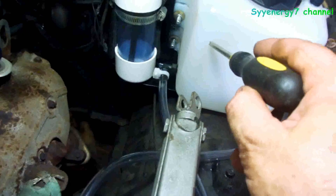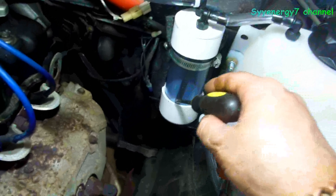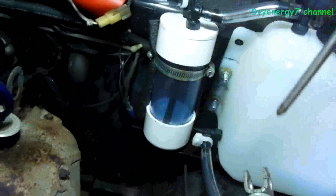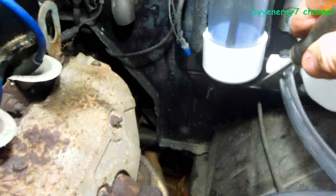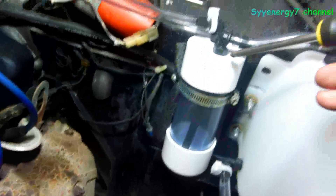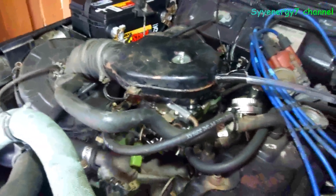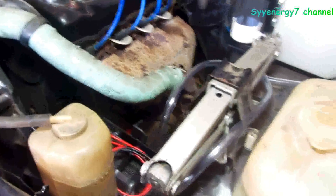So to recap the plumbing: it goes out from the reservoir to the bottom of the dry cell electrolysis unit — this is a 16-plate unit, which is oversized for this little 1.3-liter engine. It comes out the top, goes back into the reservoir, bubbles up through the electrolyte, goes out through a hose, bubbles down through the plain-water bubbler. All the mounting is 10-gauge steel wrapped in foam so it can't rub through. I over-built this thing, honestly.